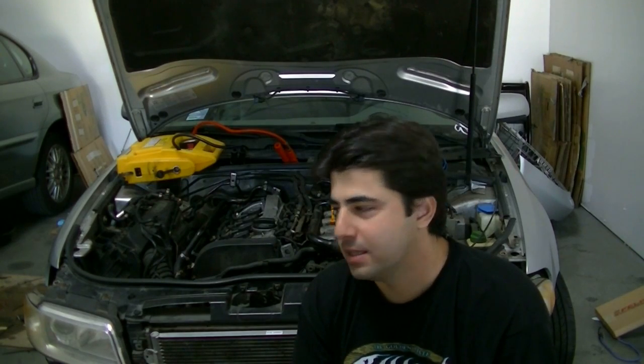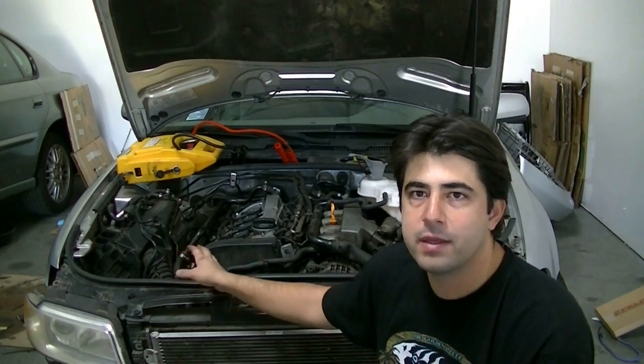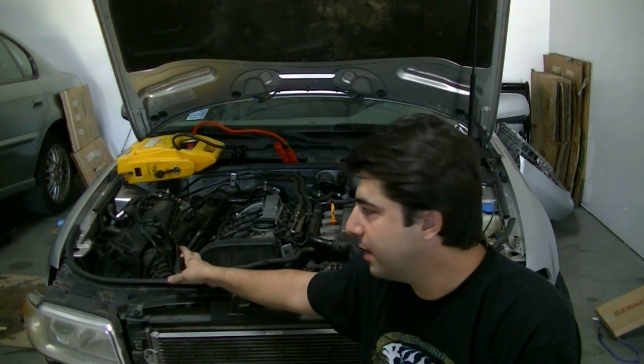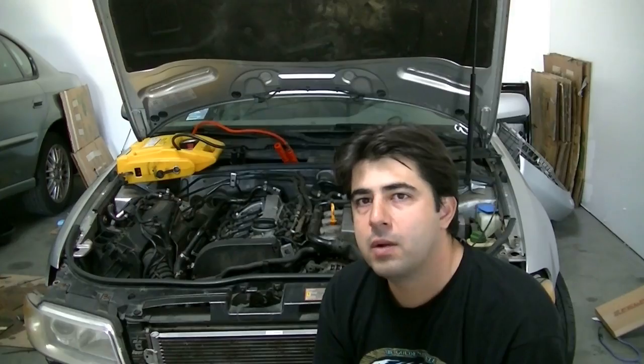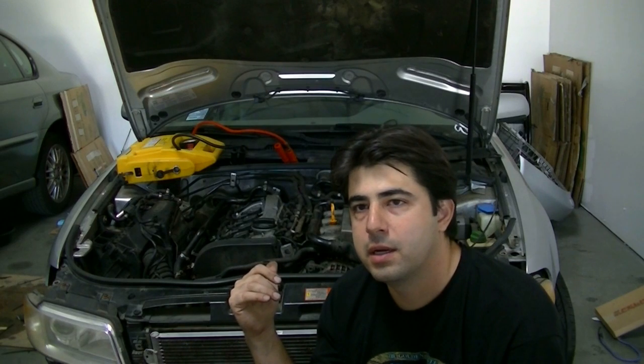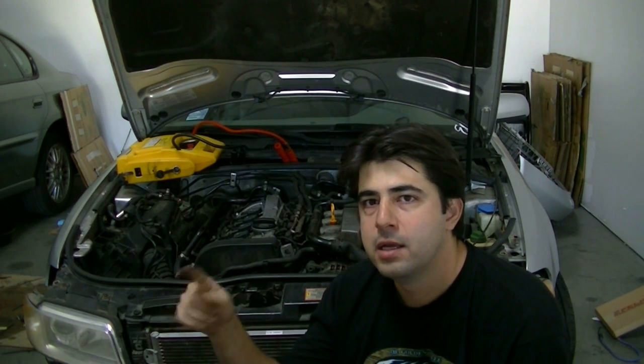Finally done with this project. Going to put the bumper cover back on and this car should be road worthy. Before that, I'll run the car and make sure there are no leaks, it's not overheating, and not misfiring. There was actually a lot less valve lifter ticking and camshaft clacking than I was expecting — pouring oil over the lifters and cranking the engine before starting probably helped a lot. What I'd recommend is starting the car on the old engine oil, letting it idle for five minutes, and once you're sure it's not overheating or leaking, change the engine oil with a new filter. That way you remove any debris from cleaning off the cylinder head and top of the block. Hope you liked this series — give it a thumbs up and subscribe if you want to see more. Thanks for watching.